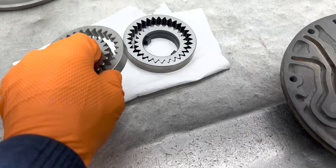When you get over to the 400, picking the best pump for the 400 would be this one right here. If you notice, GM put a little pocket of oil back here on the back side of this gear. Because when you put a trans brake on it, it does the same thing — it tries to shove the gear that way. And they added a little bit of oil right through here to keep it from running dry. If you look at this other one, the pocket's not there. So you could come in here and cut your pocket in it with some tooling to put some oil on the back side of that gear.